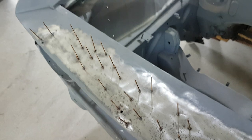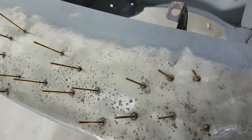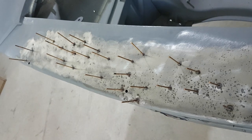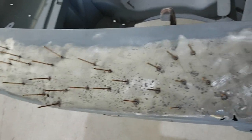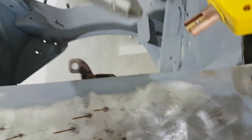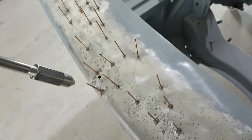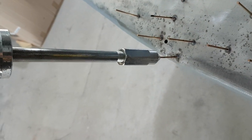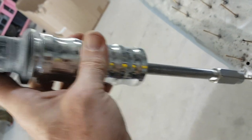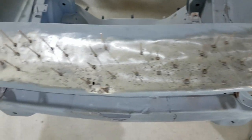We've done that across the entire deck in all the little low spots after we've cleaned it up, and you can see we've done it in an array so that we're going to get lots of lifting across lots of areas gently without trying to do it all in one go. This is the other piece that comes with it, which is a slide hammer. What it does is it sits across the stud like that, you tighten up the lower portion there, and then using this heavy sliding hammer you just ram it up with as much force or as little force as you think is necessary and you just gently work your way across.